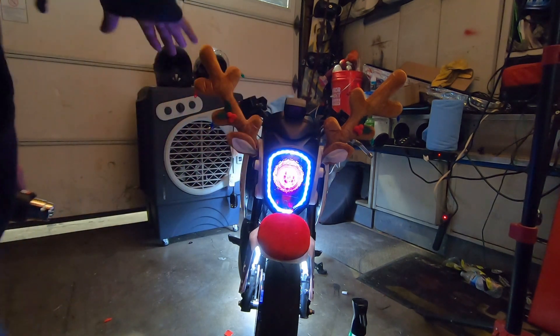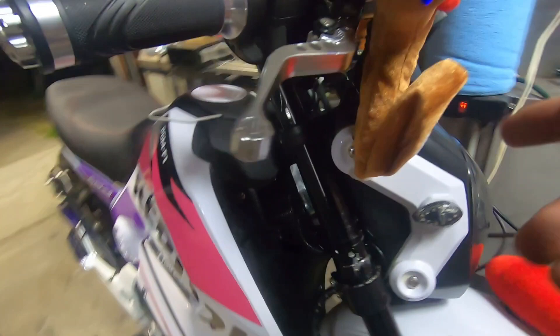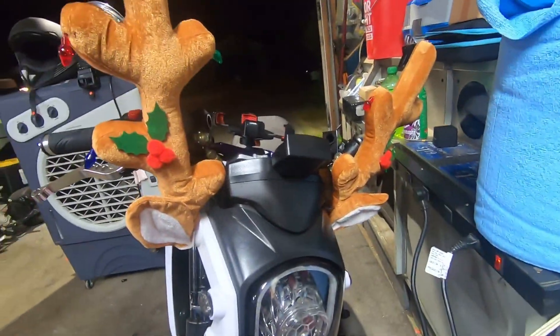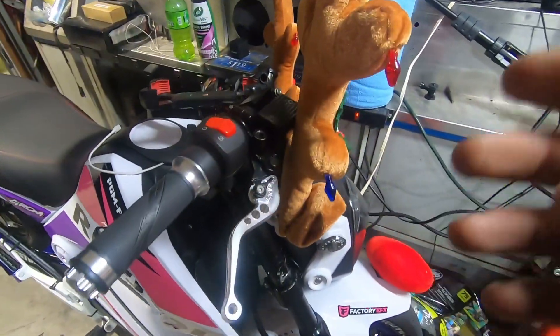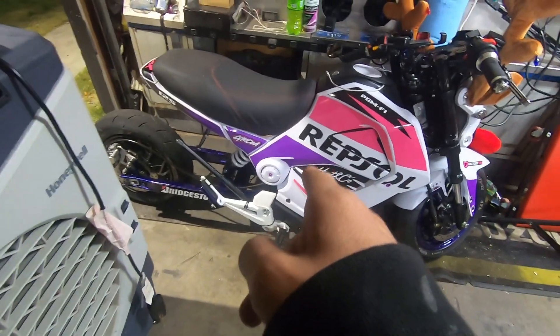Update: I ended up taking off the ears and the double-sided tape because as I went for a ride, they started falling off. So what I ended up doing was drilling an eighth or quarter inch drill bit through here, taking off the bolt for the fairing for the headlight, and leaving at least a sixteenth of an inch of plastic. It's pretty durable so it should be fine, it's not gonna fall off. Everything's sturdy and secure. I prefer that over the double-sided tape - this is more trustworthy. Plus nobody can steal them because they're mounted. Y'all take care and stay motivated.